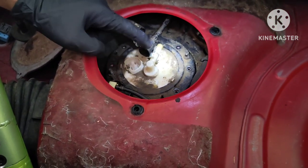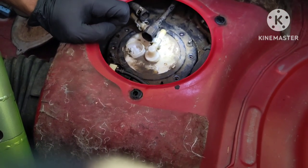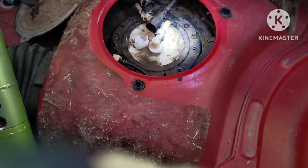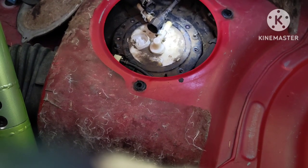And there it is. You're going to reconnect your fuel lines, put your 8mm bolts back on, reconnect your fuel line plug, make sure everything is in, check for no leaks. Alright, let's get it all buttoned up.